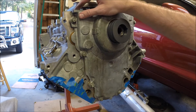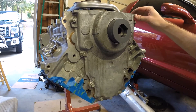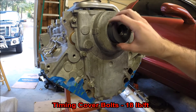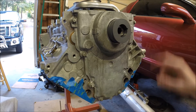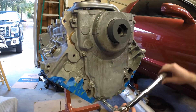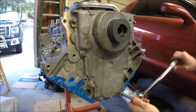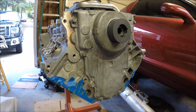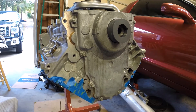We've got it snug. Let's put the plug in place so it doesn't move on us. These get torqued to 18 foot-pounds, and then we'll be able to take this piece out. We'll also use this tool to install the front crank seal. Now we'll pull this out and install our front crank seal.